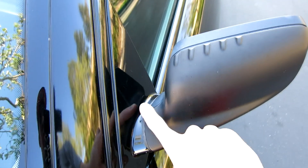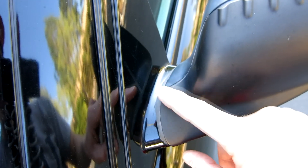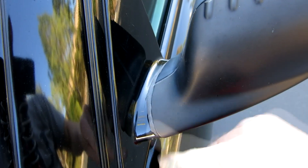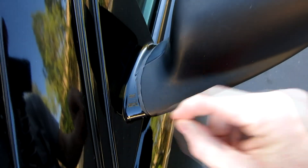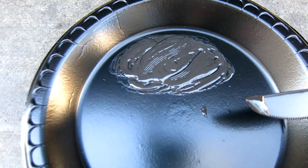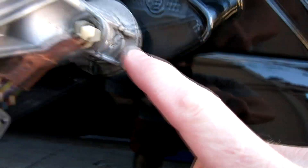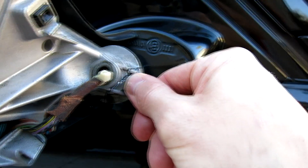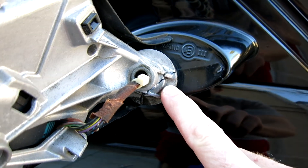So we're going to do that same thing and blend it in really nicely. I would have a wet rag next to you just in case you smear any — instead of putting it on your fingers or hands, just wipe it up with a wet rag if it's dripping over or you didn't get it in there with a knife really nicely. Alright, that's the color you're going to get — kind of a dark matte gray-black. I've already replaced a little piece and recovered it, put JB Weld all under the bottom of that. It's clean and pushed in. It will dry and cure in about 24 hours but dry really nicely in about seven minutes.